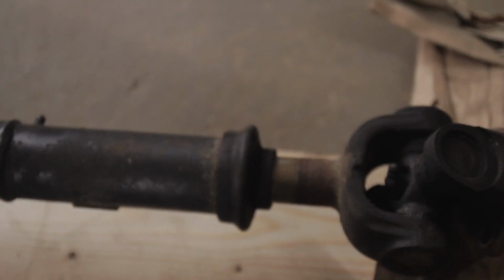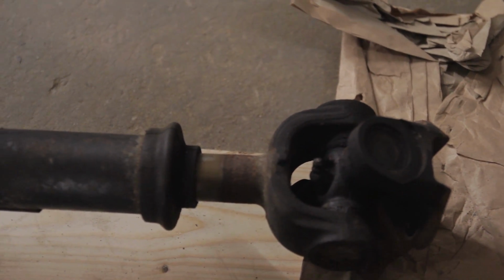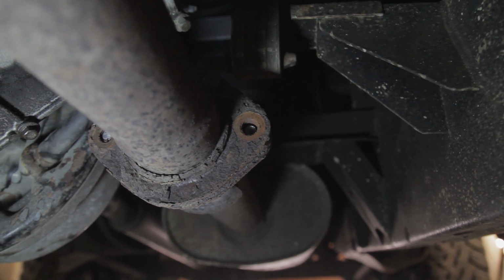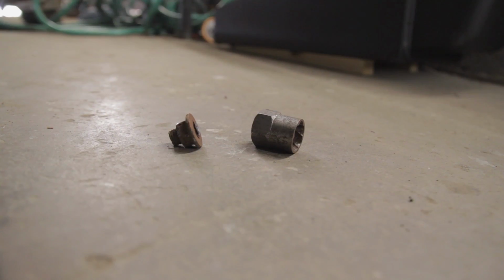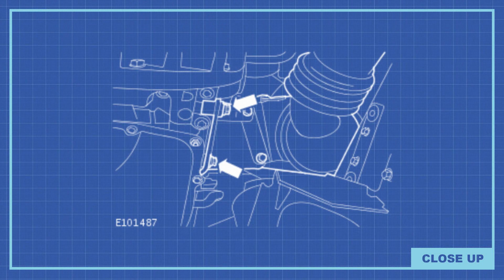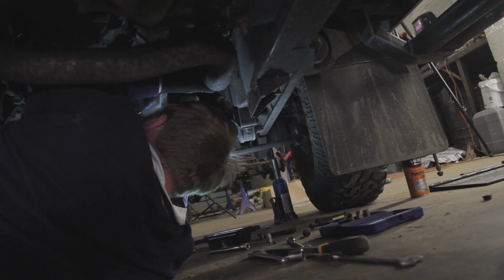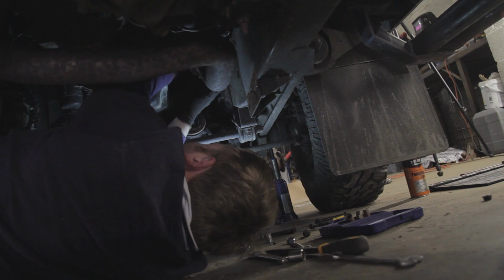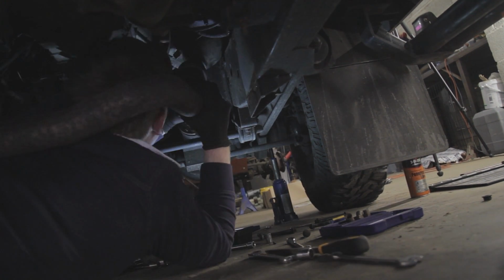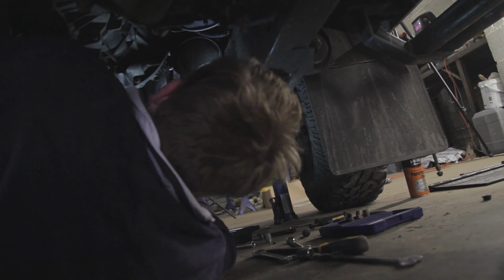The bolts on the exhaust will need to be undone next. These can be heavily corroded due to exposure to road salts, and as you can see here, ours have just completely sheared. We had to use Irwin bolt extractors here, which were the only way to feasibly undo the bolts. Remove the 2 catalytic converter mounting bracket securing bolts, and then the catalytic converter pipe. Now this can be a bit of a fiddle to remove. You may need to undo the catalytic converter shield whilst it's in place to be able to get this through the gap between the engine block, the bulkhead and the chassis.